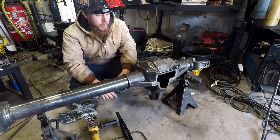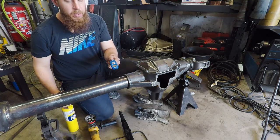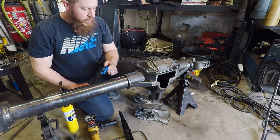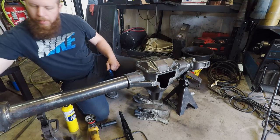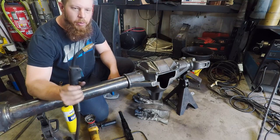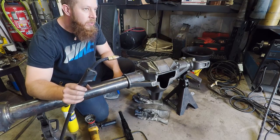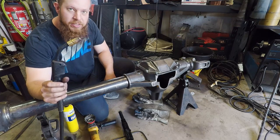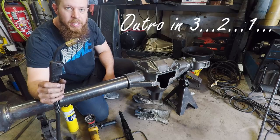All right, I've got the map gas here. And then I've got my little temperature guy here, which will go up to like 400 degrees or something. And because I should mention, I've got Nicor NI55 wire in here from Blue Demon. It's actually like a nickel iron mix welding wire, and it's perfect for this type of welding steel to cast. So less preheat is necessary, and it's a whole lot less likely to crack.